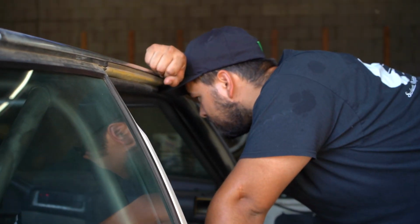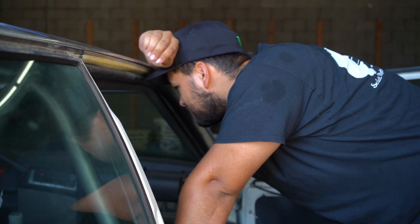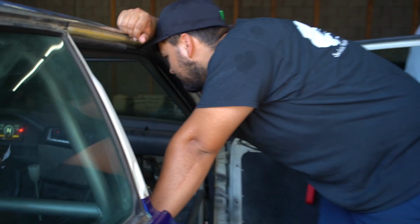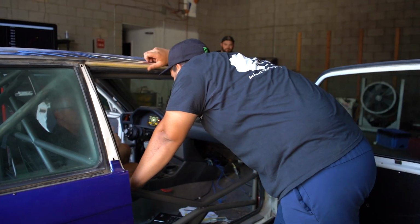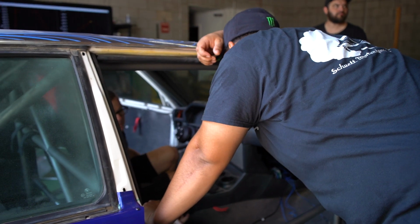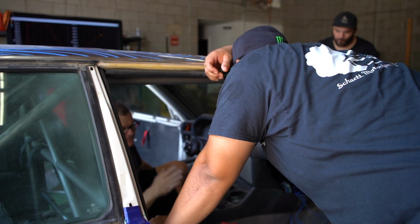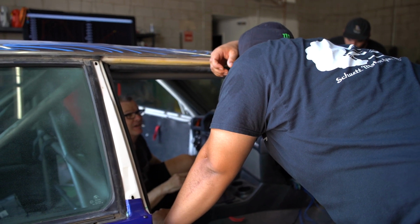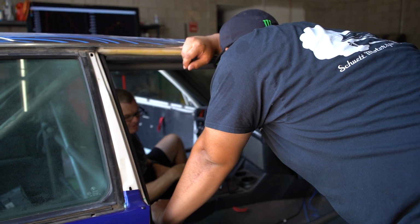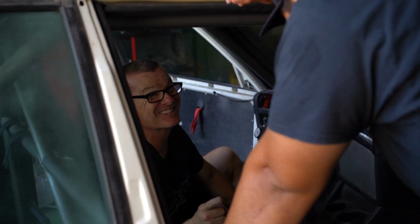It needs to know that you're either a certain number of teeth after the gap or a certain number before. And it's usually better before. What was happening was it would come around at the same time, and so it would reset. It thought it was here, and then it would reset to there. It thought it was here, and reset to there. So he caught that, and if it was a VVT, we couldn't have done what he did. Because what he does is he basically looks for the sync, and he tells it to stop looking for the sync above 1200. So now I have to physically put the timing light on it and make sure that we're good. What we command is what we get, and then once that's done, we're good, except that we're going to be out of time. But at least we solved the problem.